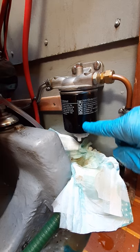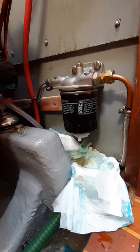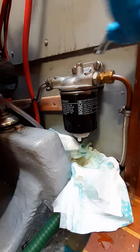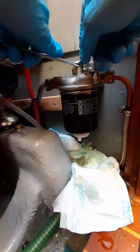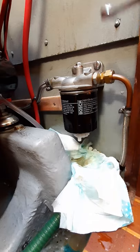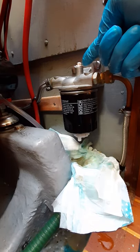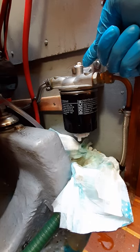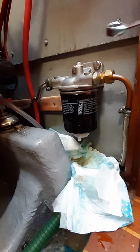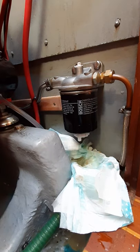And what you want now is for this to fill up with fuel from the inlet pipe here. To do that you've got to get rid of the air on the bleed valve at the top here. So you just undo that. You can see that's bubbling — bubbling the fuel out. I can hear it as well. It's filling up the container, the filter, with the fuel.